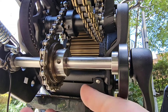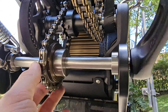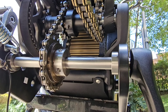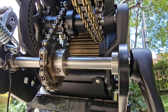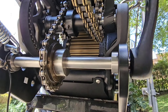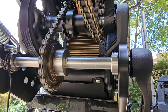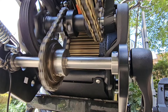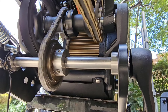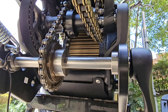The chain is now closed. Note that we haven't tightened the freewheel yet, so you can spin the pedals backwards freely. Now we're going to use the throttle to align the freewheel. Turn on the bike, make sure you can spin the pedals freely, then accelerate very slightly for a little while — that will help the freewheel self-align.